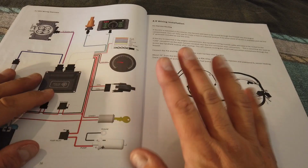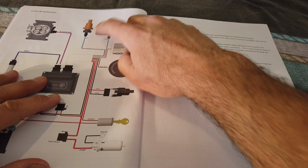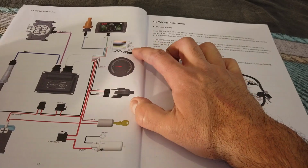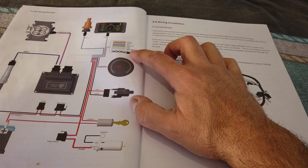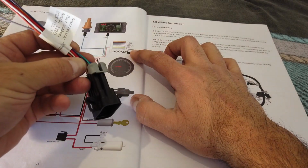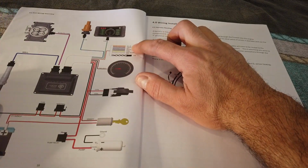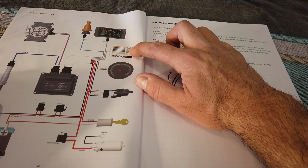Well, at this point, I'm down to wire harness completion. So the last thing I have to do, apart from hooking up the O2 sensor, is figure out which wires I need to hook up on the loose wires connector, which would be this one. Okay, so here's the deal. I don't have AC in the car yet. V-main is really not used. It's for something in the future. It provides voltage for the future. I think rev is for rev limiter, if I remember right.